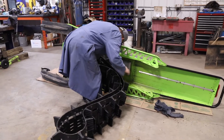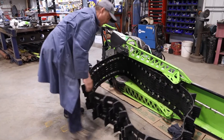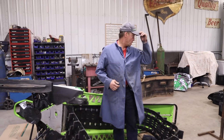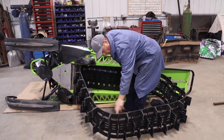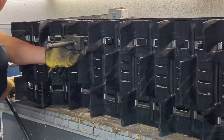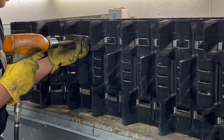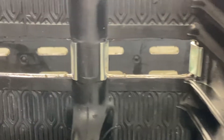I did manage to take a little bit of weight out of this track, but then I put some clips on so it adds a little bit more — but it should be pretty good. Most manufacturers are coming out with every second clip missing for weight savings. It does not help your sled turn over at all because the rubber gets sticky on the slider. To put clips on — as you'll see in the video — Ken at Mount Magic does that kind of thing. He's good at it, and for a tiny fee he'll do it for you.